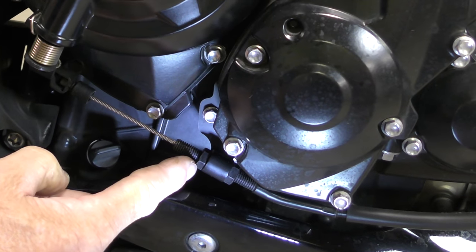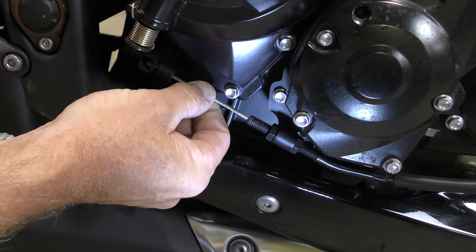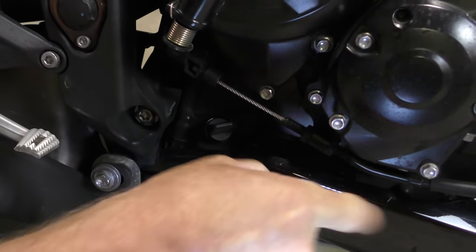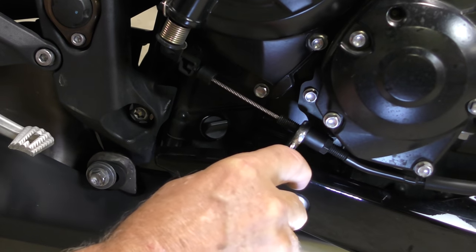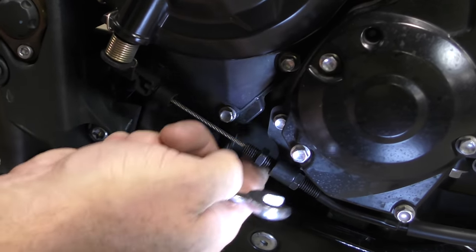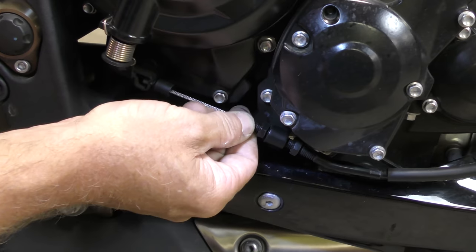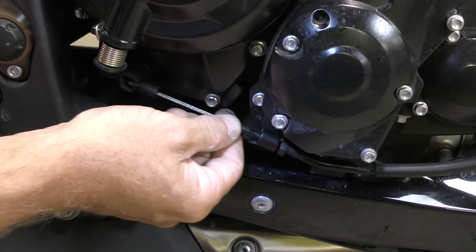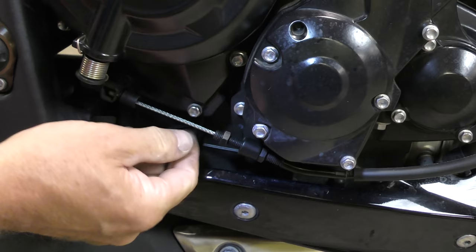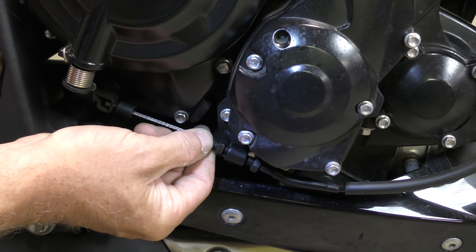This is the lock nut. We've got a lot of thread left here for adjustment. As it is tight, there will be a ton of free play — see it? So we need to get that free play removed. To do that we're going to move the adjuster this way. Task number one: loosen the nut. Now the nut is loose, we can move our adjuster. The question is how much do we need to go to make sure we've got some free play. Does the nut stop before the clevis? Yes — so we went too far.